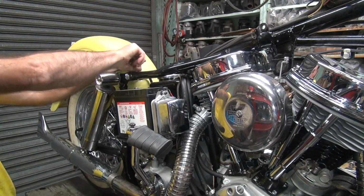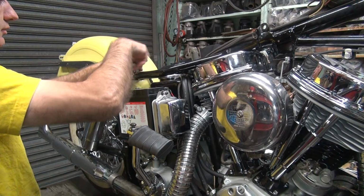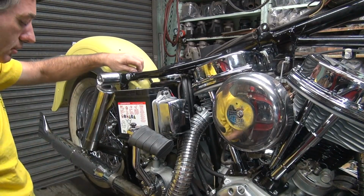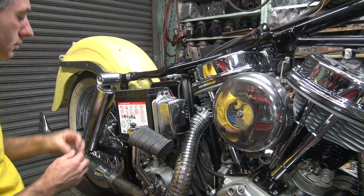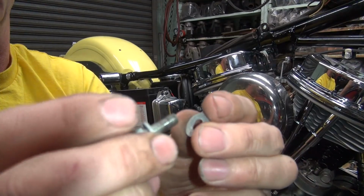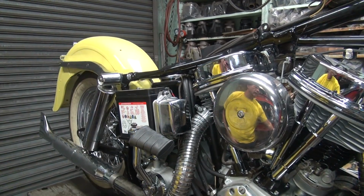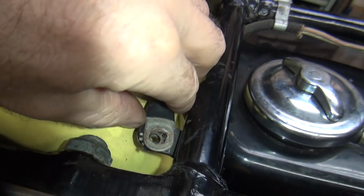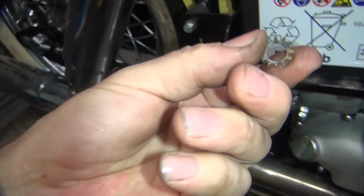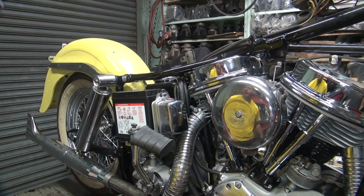So that wasn't even very tight. I could explain quite a bit of what that was all about. Got a nut on the bottom. Nope. So we have a bunch of corroded hardware. Everything on here has corrosion on it, so that's not helping the power delivery. And of course we have a 1/4" bolt with a 3/8 hole. And we got a star washer underneath trying to dig into the frame, which has rusty frame there. And that's a rusty cotter, rusty one of those also. So there you go, you get all kinds of rust going on. No wonder it doesn't work.